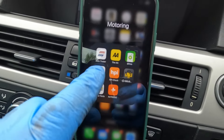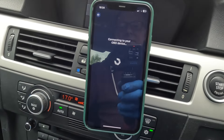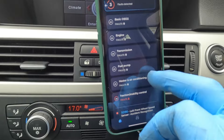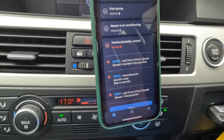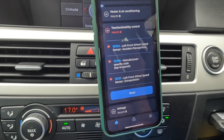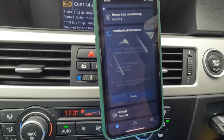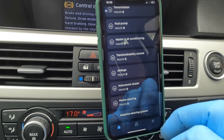Back in the car now. Post repair is just a case of resetting the fault codes. Here we go — traction, stability, control. Those are the codes there. Accident recognition — that's strange, that wasn't there before. Maybe it's because I removed the sensor. It's just a case of resetting the car. Okay, that's all reset.